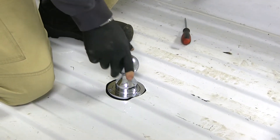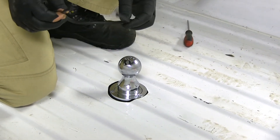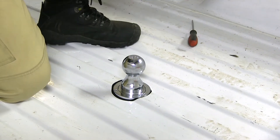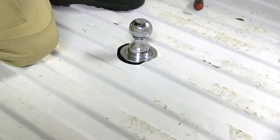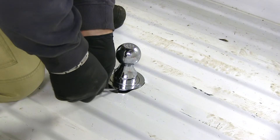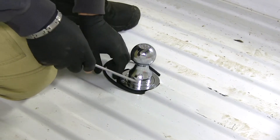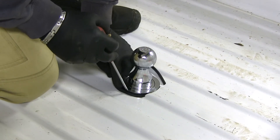I dropped the ball down inside of my hitch. In your kit with your center section, it's going to come with a little rubber seal. This is completely up to you — it's a matter of personal preference. It's going to be split and you can put it on this edge; it just makes it look a little nicer. If you take your ball and set it in there before you tighten anything up, you can actually move your hitch to align it. You can also put this on before you put your center section in if you want, but it does sit snug against this rubber piece, so it may be a little tough to get your center section up there.